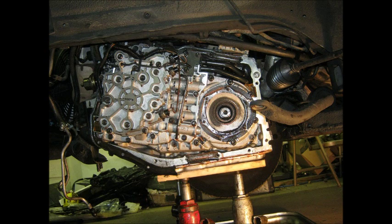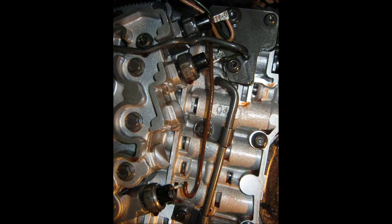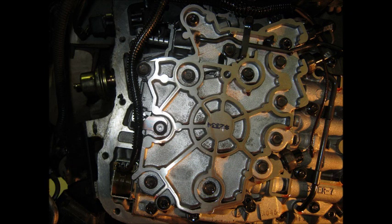There's the pan off. We can see the pump and the switches. Make notes of where all the wires go — which color wires go to which switch. The book has that information, but it's different for most of the years, so make sure you note it and get it back right, because that end cover is hard to get off.